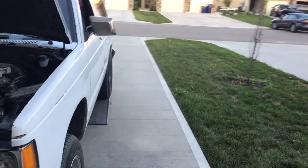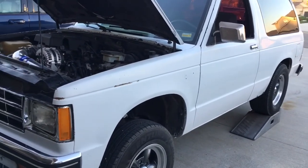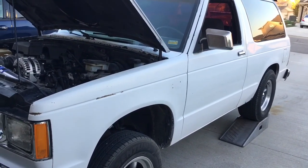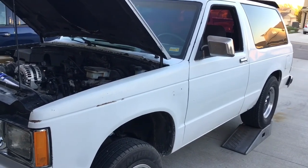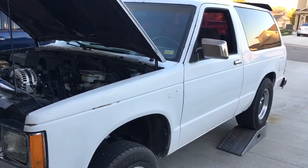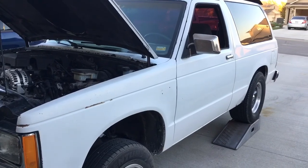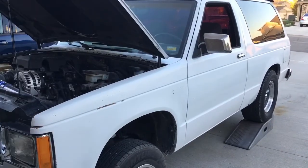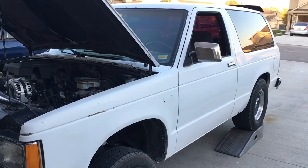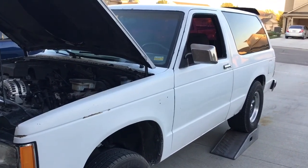Basically, when you mount it in the upright position with a regular Chevrolet bell housing — in my case the '63 to '66 cast iron truck bell housing I'm using — it makes where the transmission mount is supposed to mount at a 17-degree angle. I tried to rig it up and make it work, but over a couple thousand miles it tore the transmission mount, which was the factory S10 truck style. So I have created an I-beam style adapter that corrects that 17-degree angle of the transmission mount pad to a regular horizontal flat mounting surface.